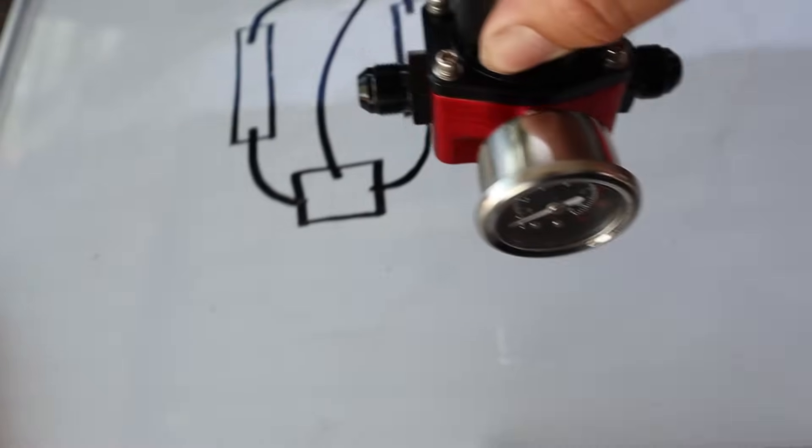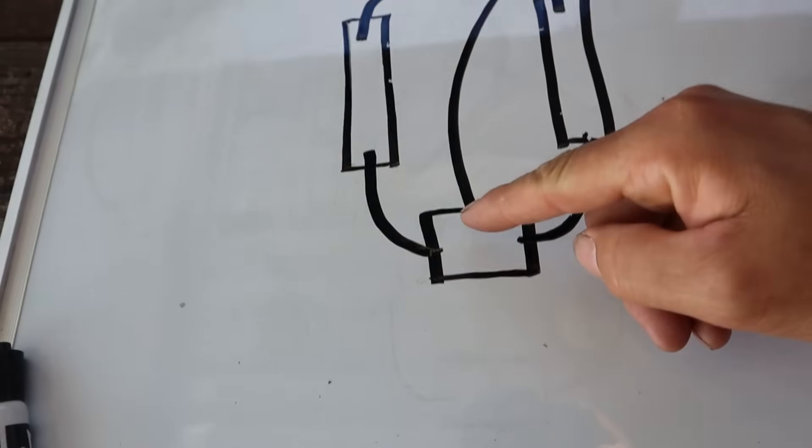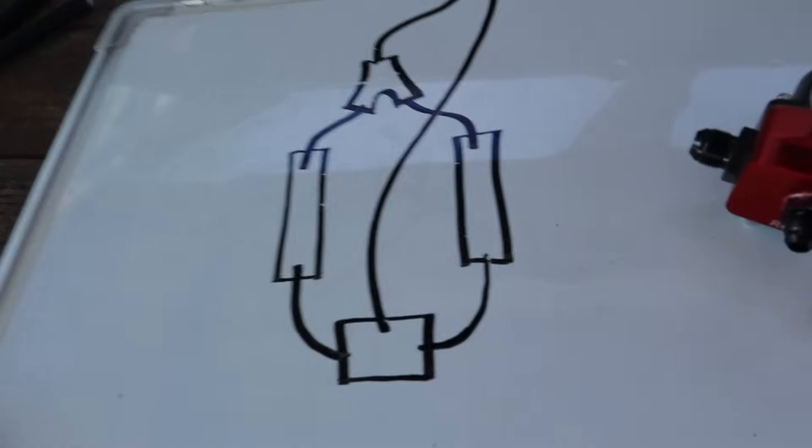That's the reason I have both my dash-8 fittings on there, and on the bottom we have our return, so the return shoots straight down the center and back. No matter what, even if you do have an issue, all eight cylinders are going to be getting the same fuel pressure. In theory you should be able to see that as a collective hole in your AFR gauge — your air fuel ratio should be impacted as a whole engine. Rather than four cylinders being lean and four being rich while showing a combined ratio that masks the difference, at least it will affect all eight.